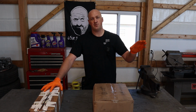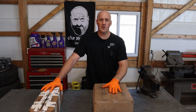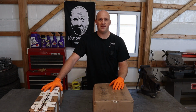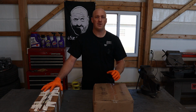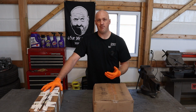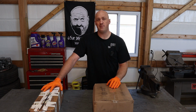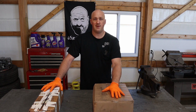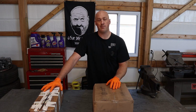The truck already has 2-inch drop spindles on it, which is great, but it's not near low enough for me. What we're going to do is install 3-inch drop coil springs, and that's going to give me 5 inches of total drop, and that's pretty much exactly where I want to be. Now for the rear suspension that you'll see in the next video, we're going to do an axle flip kit, and generally that will give you about 6 inches of total drop. So you have 5 inches in the front, 6 inches in the rear, and I really think that's going to give me the overall stance that I'm looking for with this truck. But again, this is just bolt-on stuff. There's nothing fancy here. I'm not going to be doing any sort of fabrication on these ones. This is easily something you can replicate yourself.